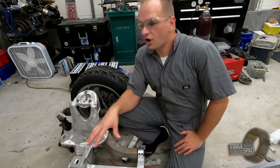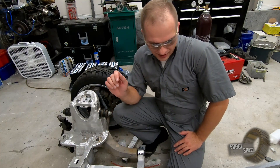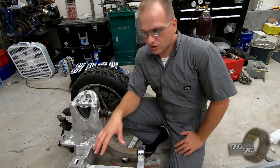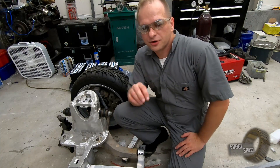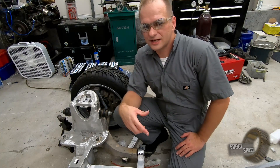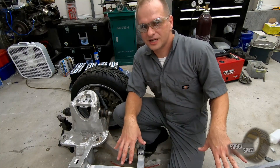So that's going to be a great seal all the way around. Now, what we're going to do next is I'm going to go ahead and put the batteries back in here, and then tomorrow after all this has time to set up, we're going to go ahead and install the controller. I have some thermally conductive epoxy that I'm going to use to bond the controller down and bolt it down as well. That way it's able to dissipate the heat into the entire frame chassis.